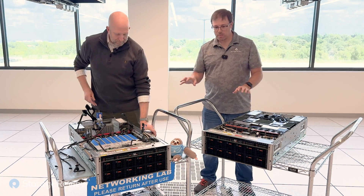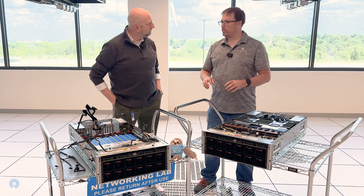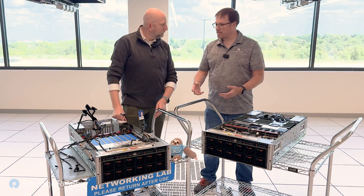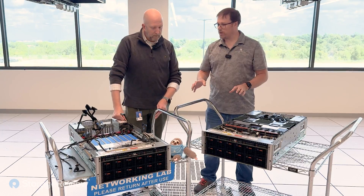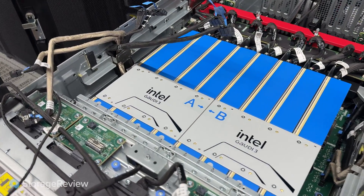On these models they are air-cooled. Dell does offer liquid-cooled options, but this is more for traditional deployments where existing data centers may not have liquid cooling on site or don't want to do a side cart. It gives a little more flexibility in where they're going to be deployed, as well as going with a traditional 19-inch rack instead of the ORV3.